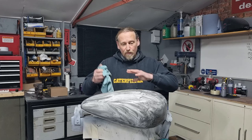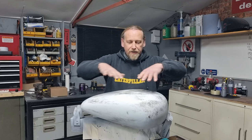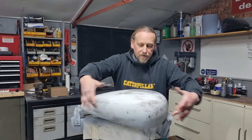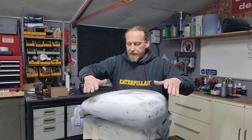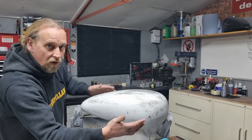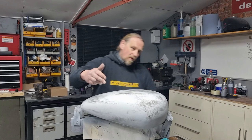Okay so that's just the first pass, we'll wipe this off now and see what we're up against. What you're looking for is a uniform finish — all white all over. With that first pass you can see how we've got some darker bits, so it just shows you. Now you can machine-do this with a sander, but I prefer doing it by hand — it's just more of a feel over the curves of the tank. The darker bits are the lower spots in the paint, so it shows we're uneven in certain areas. You want to go over again until all of this has disappeared. I can see some darker spots here and here and one on the other side.